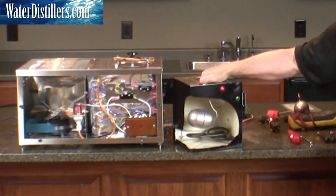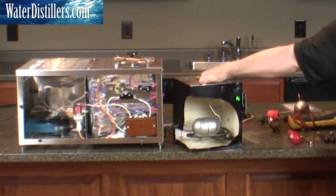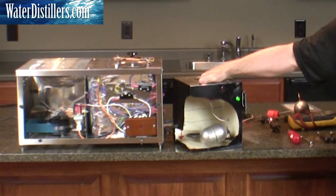This takes time — I'm accelerating it for you. But if for some reason the water supply doesn't fill, the heating element will shut off. Or if you drain it while the distiller is running, or if you have an automatic drain valve on there, it will simply go to shut off without burning up the heating element. That's the purpose of it — to keep your heating element from burning out by not having water.